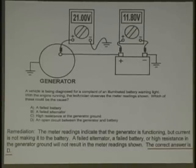So you got an issue here. This thing is going to the wall, going, give me power, give me power. The battery, it ain't getting it, is it? So what does the computer see? The computer sees, hey, my battery voltage is low. I better tell this generator I'm going to full field the hell out of it, right? And I better get that voltage going back.